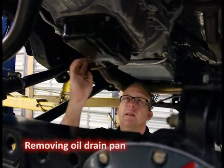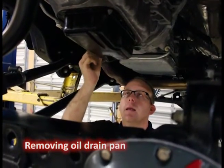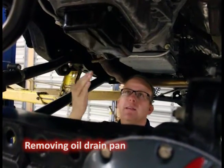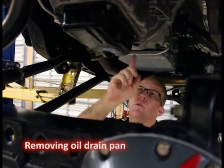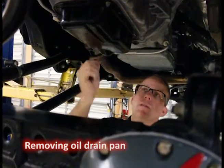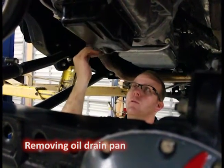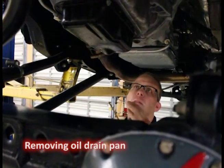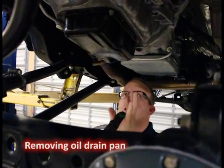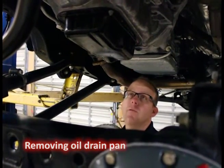As I went through it I thought there are some tips I can show here. So you take all the bolts out, you leave the two nuts, you loosen them so they're down further on the stud. Then you'll see that the pan is still glued with the silicone attached to the block and it's hard to get off.